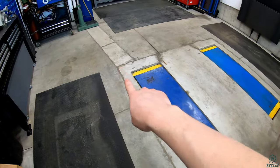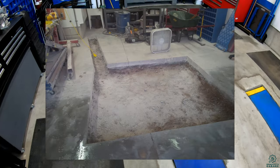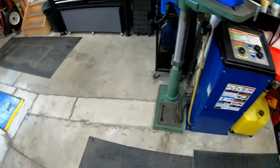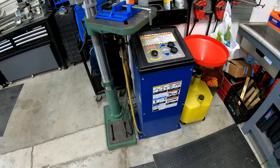You can also see running up along this way a little bit of a trench I also dug, and that goes up to the console for the lift — this is where all the controls and hydraulics are for it. In the ground there's a pipe with all the hydraulic lines and the air lines for the safety lock releases.